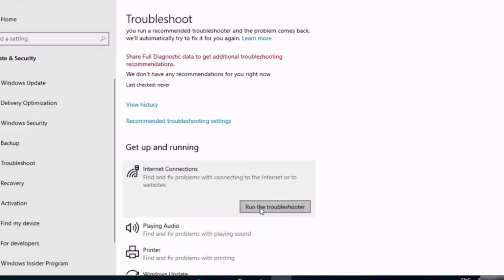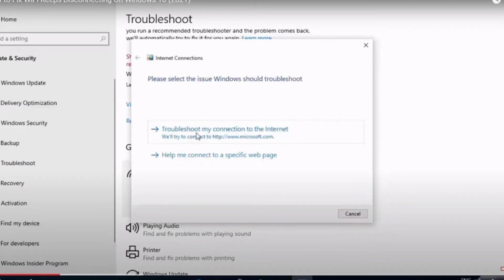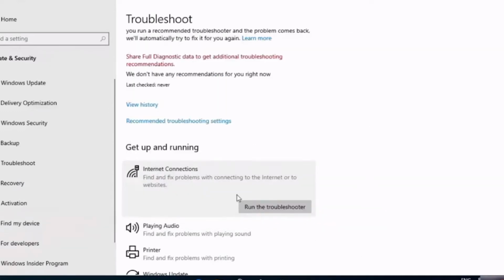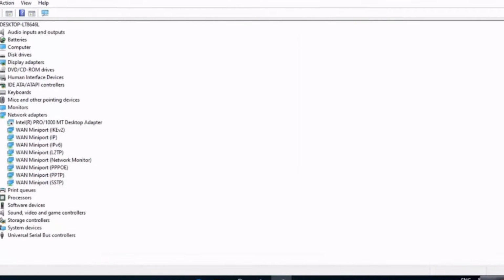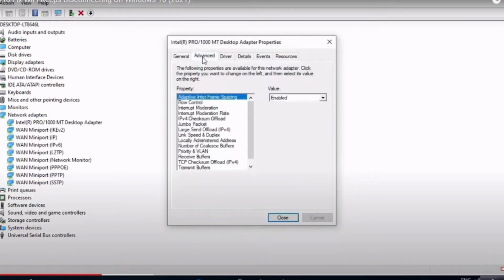Second, I check the laptop setting. I followed a tip on a YouTube video for a possible fix. I ran the troubleshooting diagnostic on Windows, which told me the Ethernet adapter is disabled. I followed the steps to fix it and solve the problem, but in a few hours the connection dropped again. I tried to uninstall and install the Wi-Fi driver and still the problem exists. I updated the Wi-Fi driver as suggested in the video and still the problem was not solved. For more details about the troubleshooting tip on YouTube, you can refer to the link below.